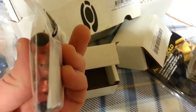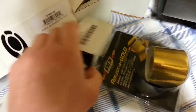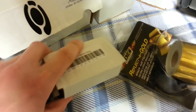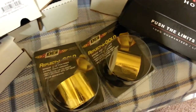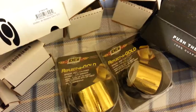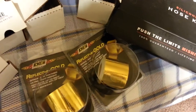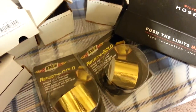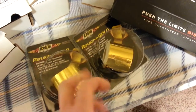These two Summit Racing boxes are identical — it's basically a Y connector. I'm going to use them both as my distribution block for the fueling, and they're all going to be steel braided lines — probably AN6 fittings. I'm also going to DEI gold reflective wrap my intercooler piping. My mechanic is actually going to use a universal kit, custom weld it, and weld brackets to secure it to my car so it doesn't rattle. The right sizing will be run in the right areas of the car so it'll flow a lot better, and with the wrapping it'll keep the heat soak down.